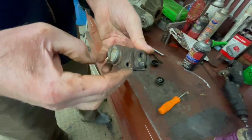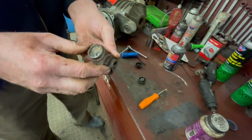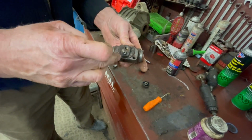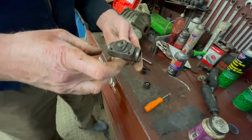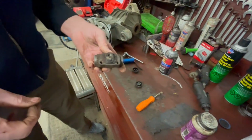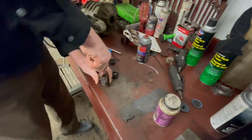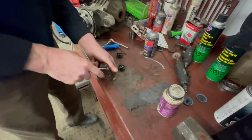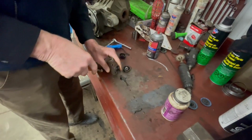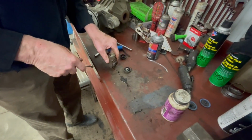Let's blow some pressure through here and see if it blows these out. See, it's rusty looking there. But see, even if they are plugged, air should still go through the bleeder, in through the line and out. Yeah, unless it's right full of crud. Maybe they are all seized. Oh, there's fluid coming out of that. So it shouldn't stop fluid from coming out.